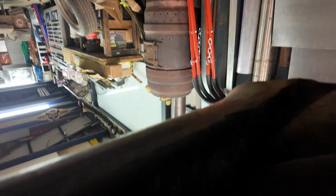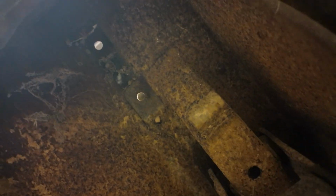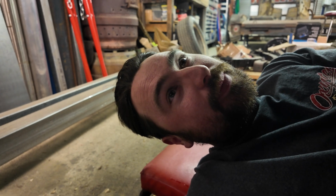So the rivet, where's the camera? Let's go back here. There we are. So rivet, rivet, rivet. There's a couple of rivets in there. They're big factory rivets to get drilled out, and then I'll have to clean up this area with a wire wheel somehow and find the spot welds, because these have got to come out completely, which is going to be dirty and an absolute nightmare, because what they did was just spot weld wherever they felt like. So woohoo! Anyway, I better find a spanner that fits these, and I will show you. It's not really a trick, but it's just how to get them out, really.